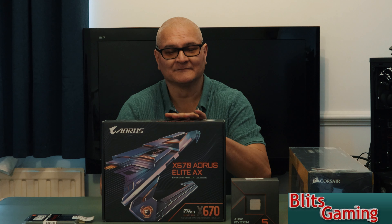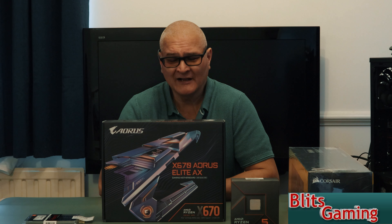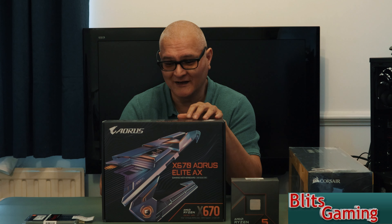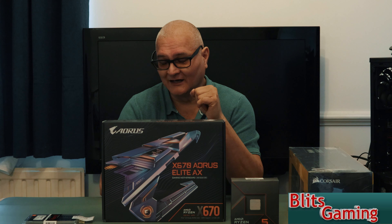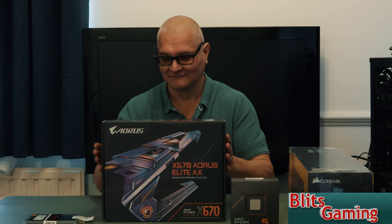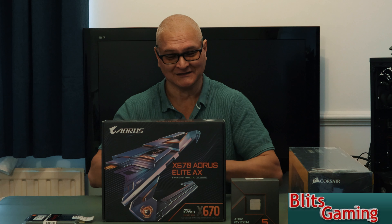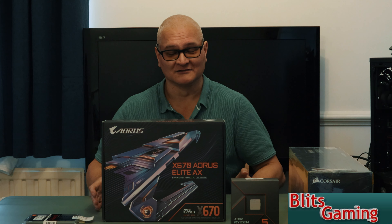Before we get into that — in my last video I stated that if you have an ATX 2 power supply, the lead you'd be getting with a 40-series graphics card from Nvidia may catch fire. In the video I did see they did catch fire, but I looked at it incorrectly. I'll put a video up here that tells you all the story and the problems — and actually there's no problem, and you don't need an ATX 3 power supply to run the 4000 series graphics cards.